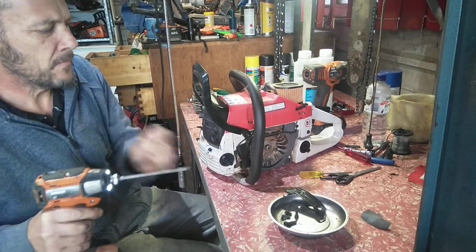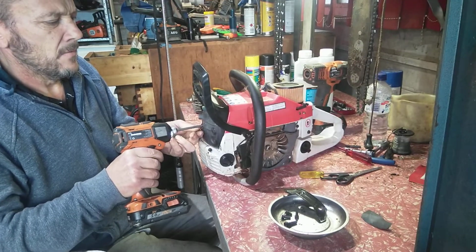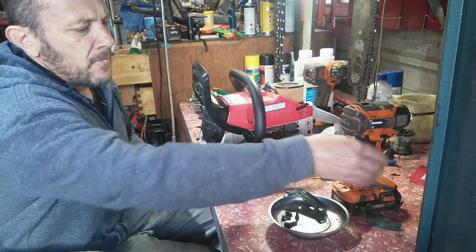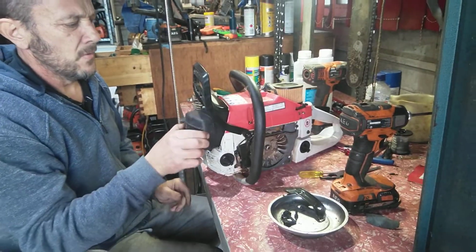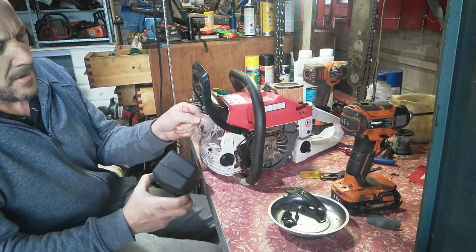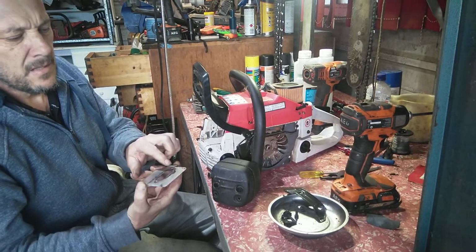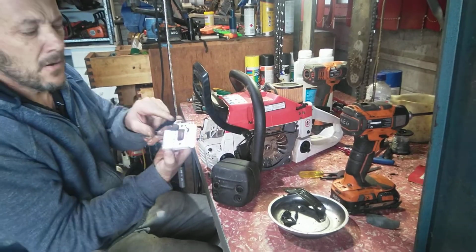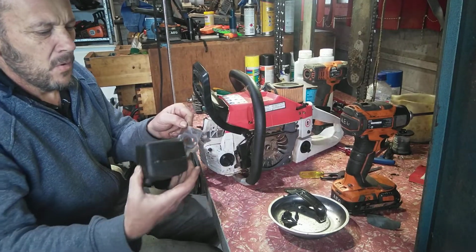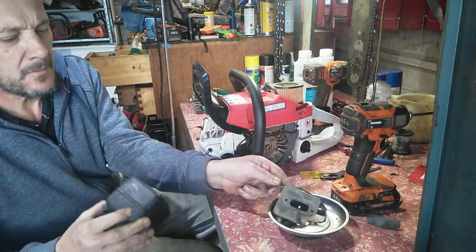That was loose. They normally come loose. Yeah. I put Loctite in that. Just a dribble. So remember how things come out, so that was in that way. Look for witness marks. See, the witness mark, you see that was from the back of the motor. So you can see that was there, so dirt builds up. After a while, you could be months away, you go, how did that go together? Look at the witness marks.